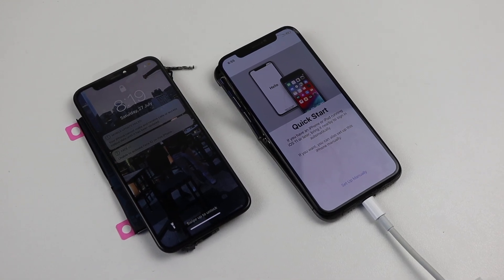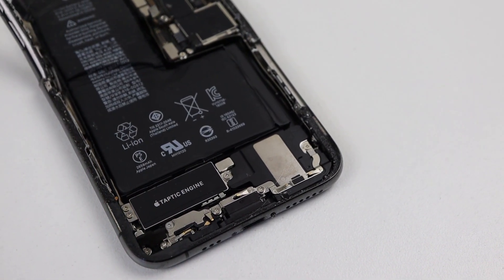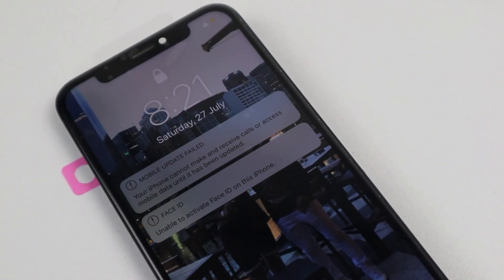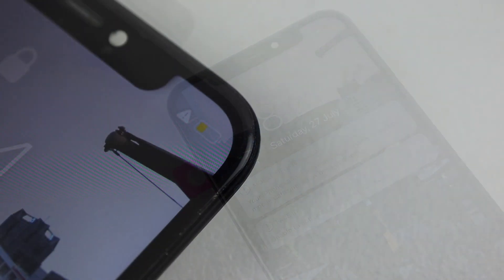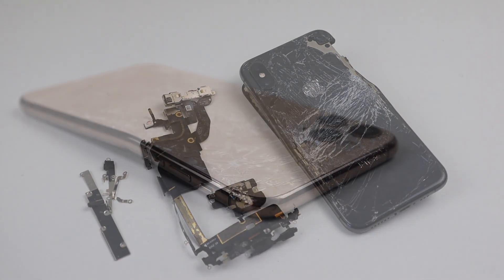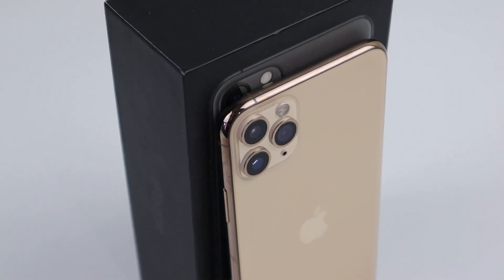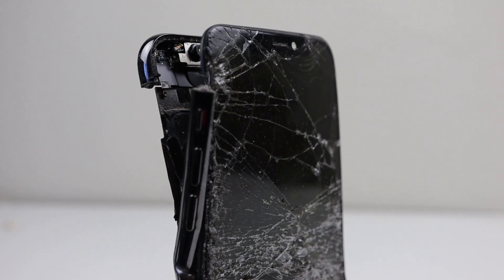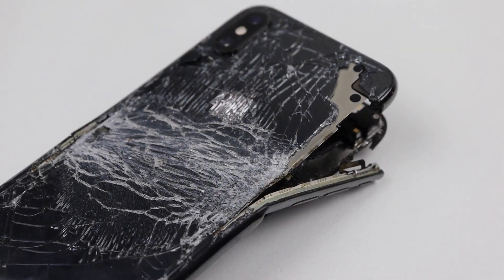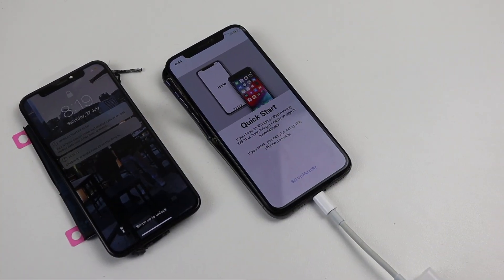Even with the devices not working, I still think I got an amazing deal — there's still lots to salvage from these phones. The charging port, Taptic Engine, speakers, screws, and cameras can all be reused. My advice is, if you're looking to buy and fix an iPhone X or XS model, avoid any with bad touch, a warning icon in the status bar, or one that says it cannot activate, otherwise you'll be facing the same issues as I am. Based on my personal experience, the iPhone 11 Pro models hold up much better to damage and bends, so they seem to be improving on this board design. This has been a Hugh Jeffries video — hit that subscribe button and consider checking out the phone restoration playlist for some successful repairs, unlike this one. If you're looking for tips or what tools I use, check out my website linked in the description. That's all for this video, and I'll catch you guys next time.